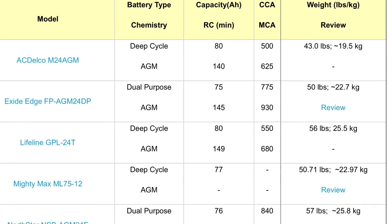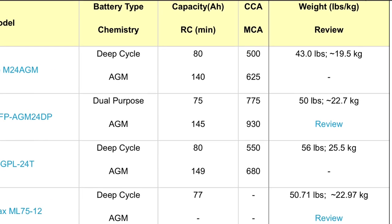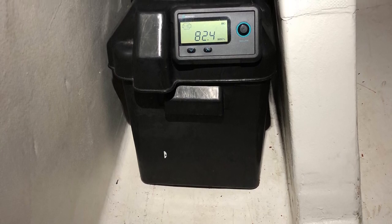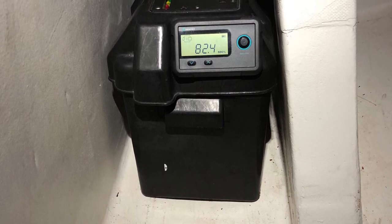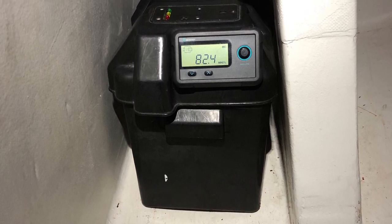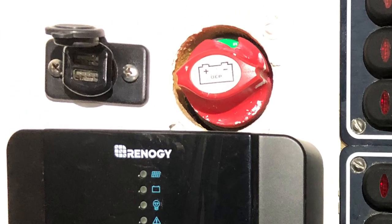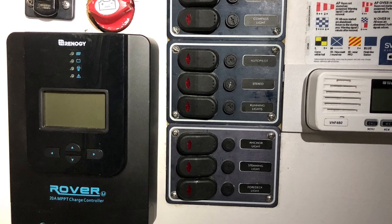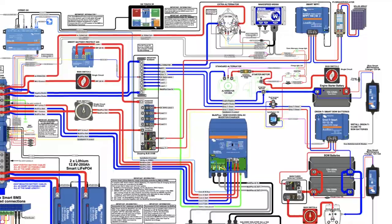A Group 24 lead acid battery is pretty heavy, with most of them weighing 50 to 60 pounds or 20 to 25 kilograms, so I also wanted something lighter. So I replaced it with a lithium iron phosphate battery. This was much better — it weighed half as much, had twice as much usable capacity, plus it had a battery management system, or BMS, that could tell us how much power was going in, coming out, and the state of charge, so we knew exactly how much power we had left. But I still only had a single 12-volt receptacle for charging my devices, plus a huge charge controller, and my system was starting to look complicated again, so I started shopping again.